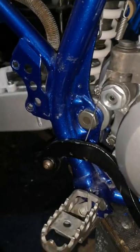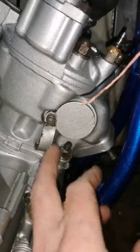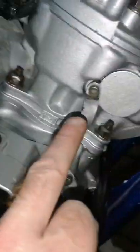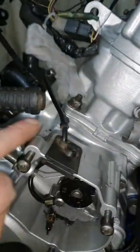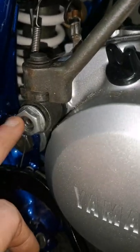And that's the swing arm tightened up now. What I'm going to do is take that out. Take this bracket off. Because this barrel's off a DTR. Where the oil bottle run is down there. And it runs through there, into there. But this oil bottle's up there, and it runs down there. So it's not going to run down there and then back into here. So I'll just take that bracket off, Loctite that, and I'll Loctite the kickstart nut and get them on.